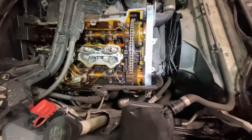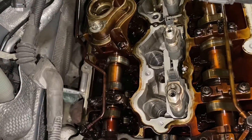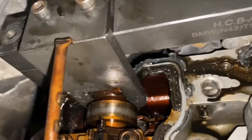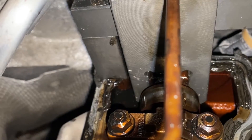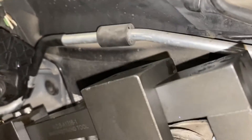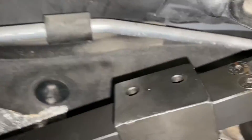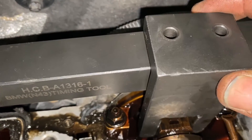We need to look at the crankshaft timing next. I did say don't get too excited — this usually when the phase wheels line up everything else lines up. In this case, exhaust lines up, no gap on the cylinder head, bolts are in, everything's flat, tight and square. However, on the intake side, bolt holes are miles out — something like 10 millimeters — meaning the angle of the camshaft is too far to the right and needs to be brought more to the left. It's on a weird angle, certainly quite a few degrees off.